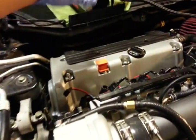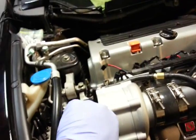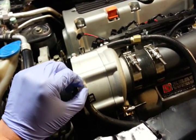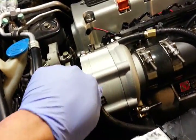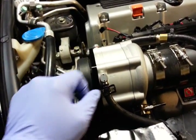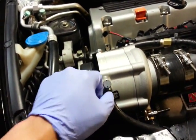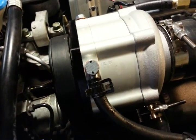So what you want to do is keep running this pump even though oil is shooting out, and tighten it simultaneously. You're going to tighten this banjo bolt all the way back, maybe just with your hands as tight as you can. Once it's completely tightened, shut off the air compressor. Then you want to go ahead and get a socket set and realign this banjo bolt so that way the holes on the bolt are in line with the oil line.